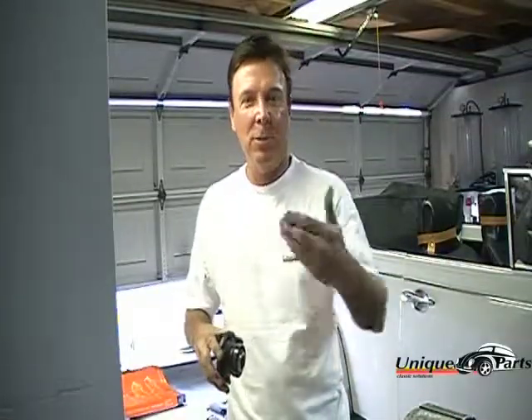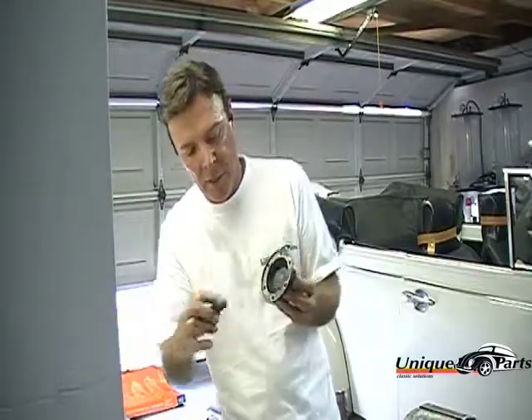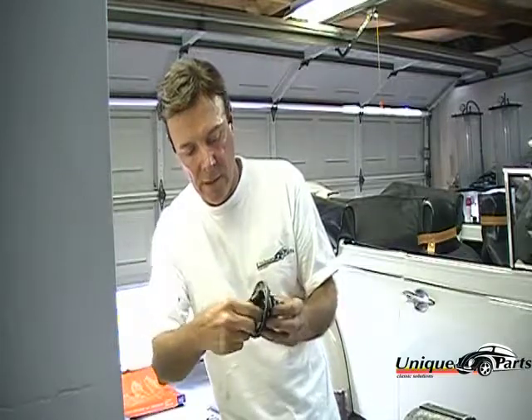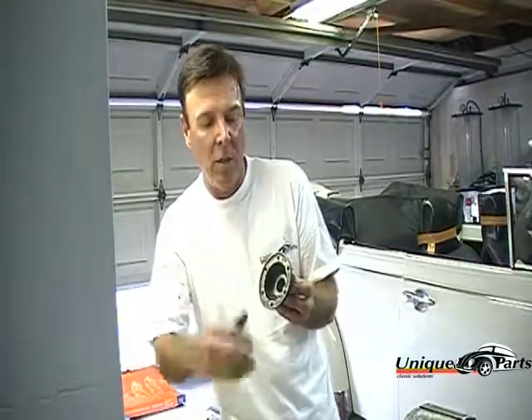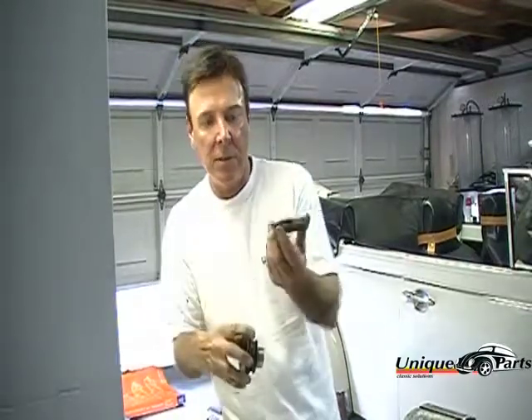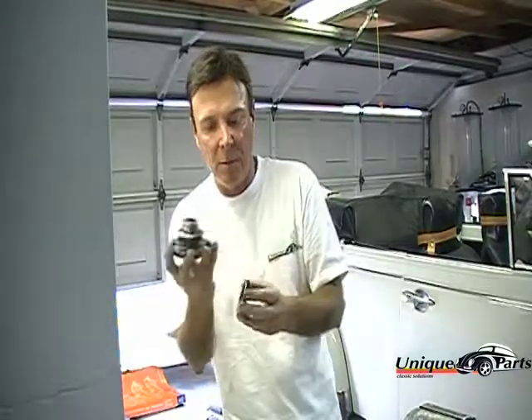Now I've shown you the tools we need to change the seal and remove the flange cover. Let me show you what that actually looks like. Once the axle has been removed, this is what the flange cover looks like. There is a seal inside here that has to be removed — I'm using a screwdriver to pry this seal out. There's also a snap ring that we have to remove from the spline shaft so we can pull this cover off. This is the seal we're trying to replace — it's gone defective. Once we've removed the flange cover, we can remove the seal.